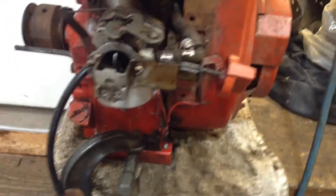He said the carb probably needs a cleaning, which it did. It had like water in it and junk — stale gas. But I put a new NGK plug in it, because that old one won't do.